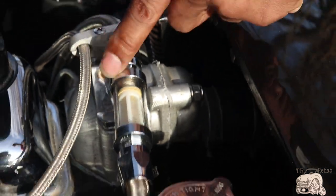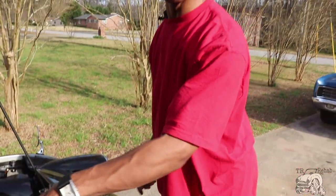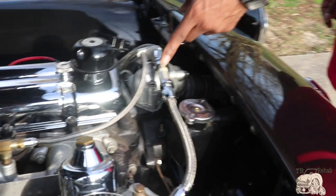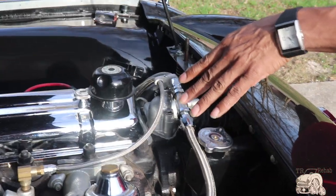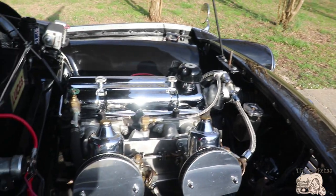This is one of my favorite little pieces on the TR, because when you start talking about these finicky SUs, they can have you chasing your tail and you'll never find what you're looking for until you break them down and test each piece. I could go in and replace the jets and everything in there, and it still wouldn't have done what this just did. This told me that whatever is happening, it's starting here.